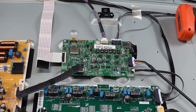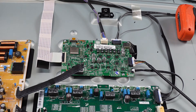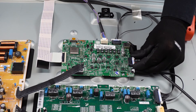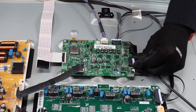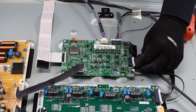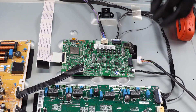The next board that we would suggest is the main board. We're going to have another short video highlighting exactly how to get the main board out of your unit as well. The first step for the main board is going to be getting all the clips and cables away from the board itself. We're going to start with these two — we're going to push down on the right and left side of the clip and slowly walk it away. You see it did come out at an angle; we can just pop that back in and use two hands to walk it right away from the board.